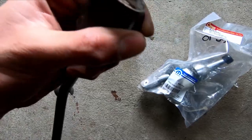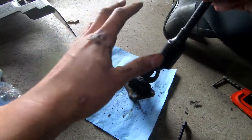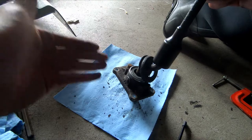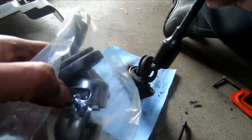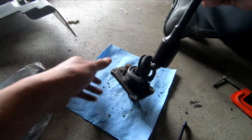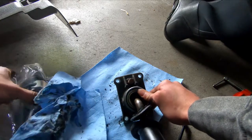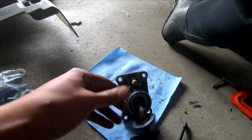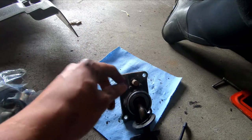I learned how to remove the shifter from the shifter housing — this is my first time doing it, so if you find something incorrect let me know. On the new one there's a little notch where the retainer bolts hold the shifter in place so it doesn't pop out while driving. To remove, you put both thumbs on it and turn it counterclockwise. It's pretty hard because it's old with a lot of debris and corrosion, so I might use a chisel or screwdriver and hammer to tap it the rest of the way.